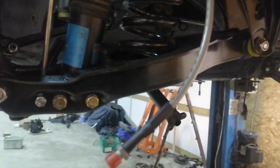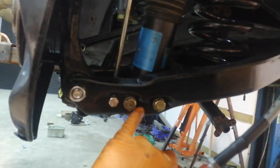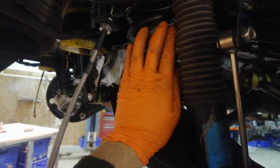working was, first of all, I cable tied these springs loosely into the socket, because they will just fall over when you're trying to lower the car down on top of it, or indeed send it up if you're working on the ground. And what I did then was I loosened up the bottom mounts here, just to get them moving a bit, because they would have been sitting a while, not been moved. And I got them lined up across here, and as I was going down, I basically got those two bolts secured and these springs into their housing. So that meant that it was sitting right for that, but the mounts obviously wouldn't have necessarily lined up.